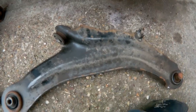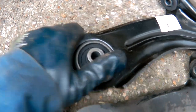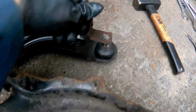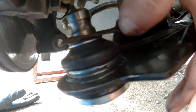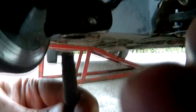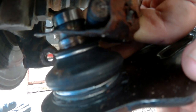So that's off. Now I need to fit the new one. As you can see the rubber is a hell of a lot better, stiffer. I've put the ABS sensor clip on - don't forget to put this around the ball joint. Now when refitting the ball joint there's a little ridge in the joint there, so the ball joint goes up there and this bolt goes through there, and it's held in place by the bolt wedging onto that little lip. You have to make sure that when you put the ball joint in it goes right up.